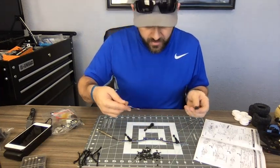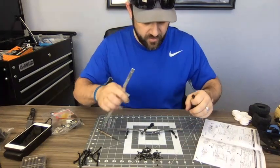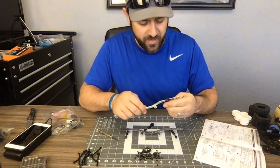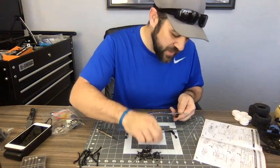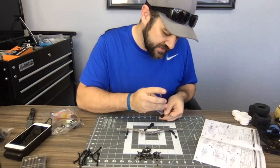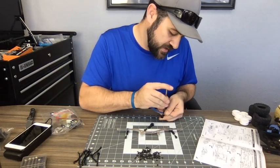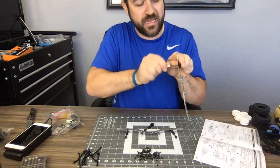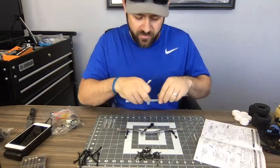And these are directional, so I can't make the bend the same, because I'm thinking that the bend in this chassis is caused by the stamping method that they used, because they're both bent the exact same way, and it's just a stamped frame rail.